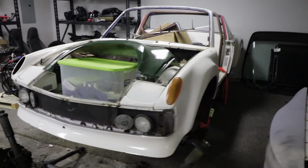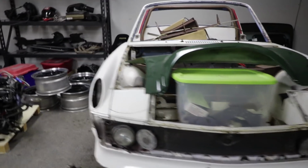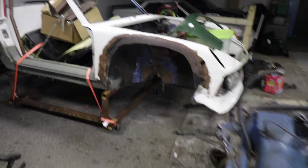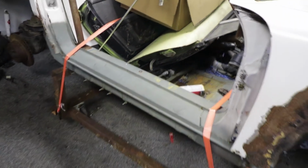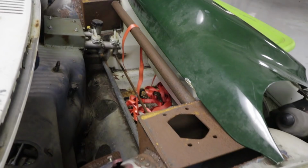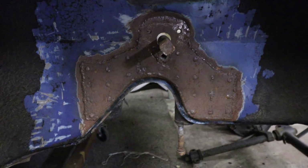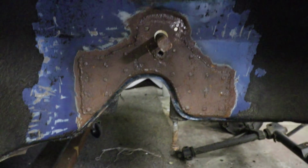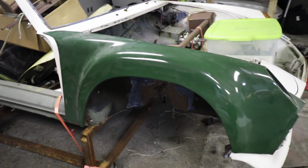So now it's mine. This side looks pretty awesome, right? This side, it's a little different. As you can see, the fenders have already been cut, but the good thing is all the metalwork's been done on this car. Like, this entire rocker's been replaced, floor pans have been done. He went ahead and made some strut towers for the car so that he could run 911 style front suspension with caster camber plates. This side's already got the sway bar reinforcement plate welded in, and that's an example of what it'll look like with the widened fenders on it.